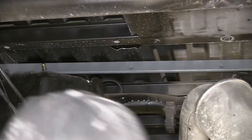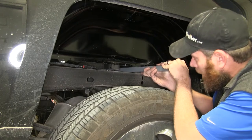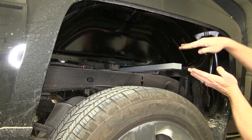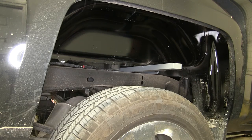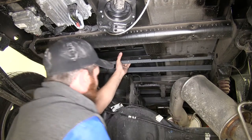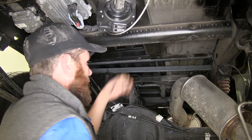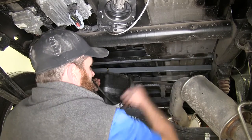Now we'll get our rear bar installed. Same thing's gonna apply here. We'll probably have to help it out. Just allow it to rest there and help it out to go the rest of the way. The holes are gonna be offset to one side. We'll get it in there and we're gonna rotate it 90 degrees to stand it upright. We want those holes to be down or toward the bottom. This is where an adjustable wrench can come in handy. Help get a hold of it and rotate it into position, and we'll want that just pretty much right back up against the cross channel there.